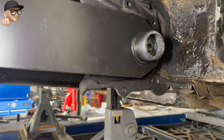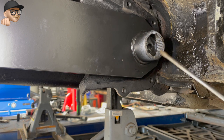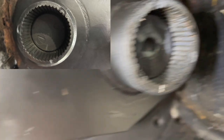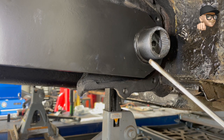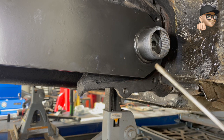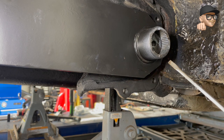If you're this far in, you've already seen me do this at least once before. Putting these things back in — this is the spring plate torsion bars right there. I've done an alignment mark here and there's another one right there inside the torsion bar. I've sprayed everything down with white lithium grease — it helps the rubber bushings not break down so quickly. I've gone two notches, two teeth actually, which over the length of this 18 or 20 inch arm translates into four inches of drop, which is pretty significant.